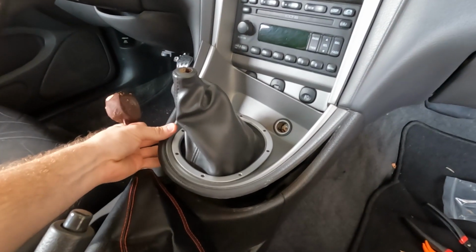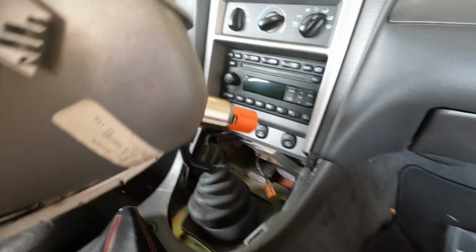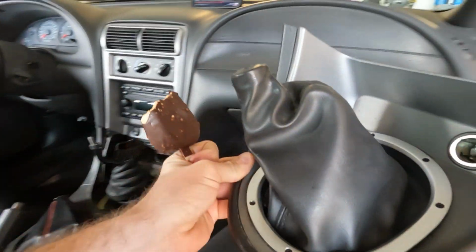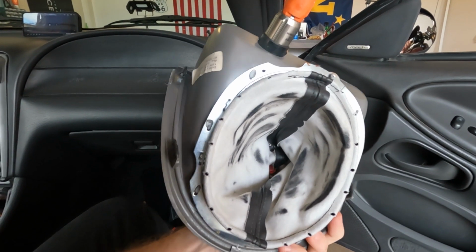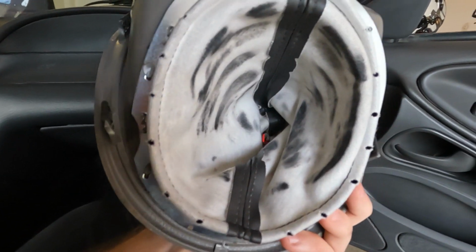Sweet. So my dad popped this off. You unplug the cigarette lighter, and then you take a heat gun and melt off those little tabs, pop the stainless steel ring off, put the new one in, and melt some tabs back on there. Easy day. Well, what would be a car project without realizing I don't have a heat gun here?